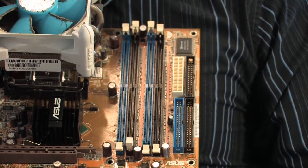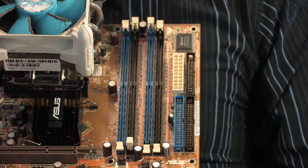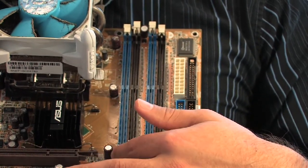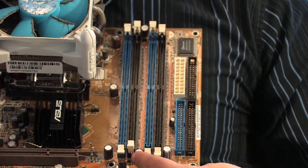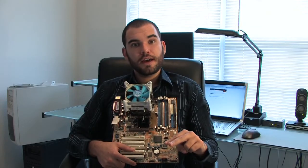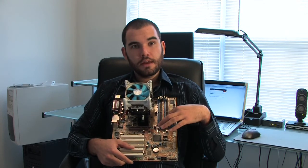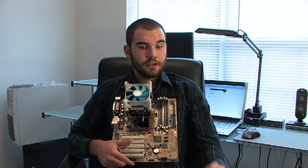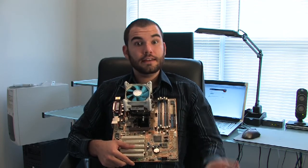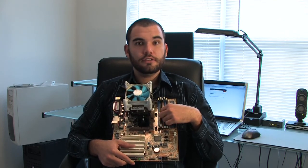And if there are more than two slots, you'll see them color-coded. In my case, I have blue and black. That's for when you put more than one stick of RAM in there — you need to match up the size with each slot. So slots one and three go together. If I had two 512 megabyte sticks, I'd make sure they go there, and gigabyte sticks would go to slots two and four.